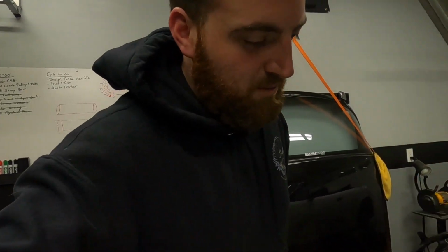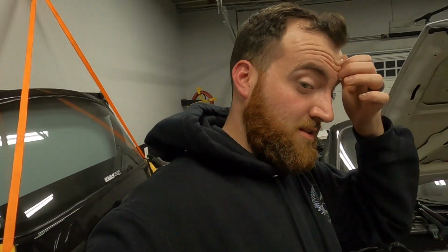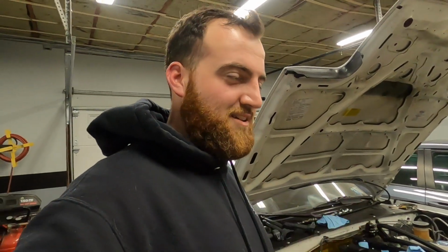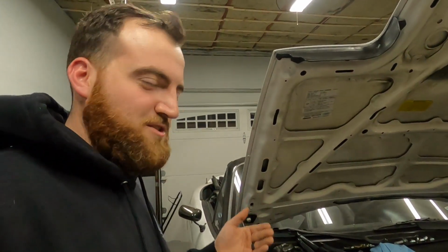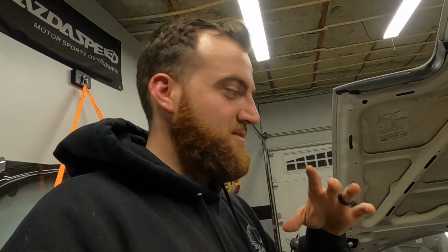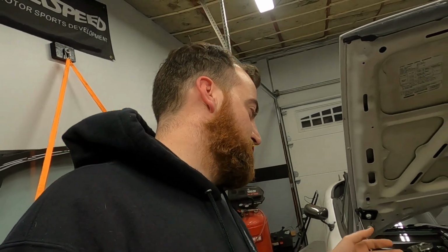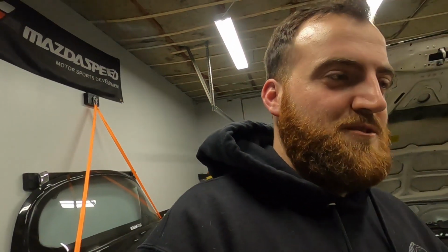I'm not sure, but I got plenty of stainless. I still got like 3.5 feet probably, and the Portaband will cut stainless. I've seen it cut stainless. I bought the right blade for it, so it'll just be a little bit of a process, but luckily I'm only gonna have to figure out a short distance, and how much the short distance is gonna shrink instead of 13 couplers. 13 butt welds ends up being a lot of shrinkage to account for.